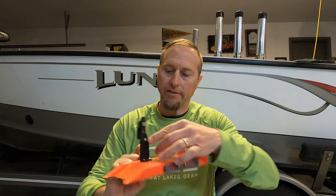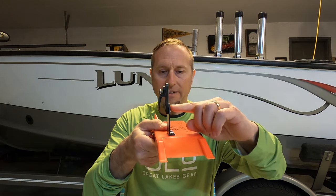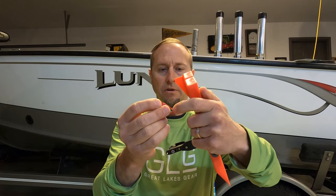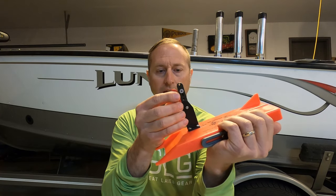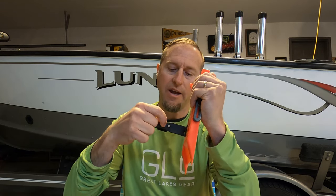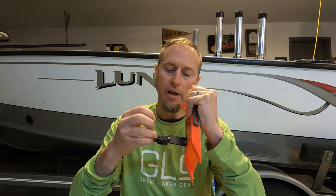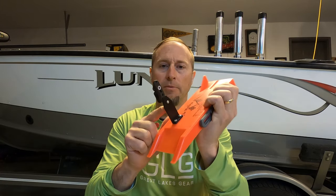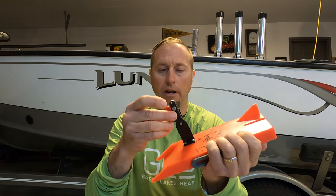So you've got this little screw and little nut here, and I'm going to pop that out. There's also a little plastic bump that pops out, and I can actually put this in that bump so this thing won't move — otherwise it might swivel back and forth. I've gotten a screw and a nut as well. We're going to have to plug this guy up with JB Weld because it's probably compromised this little plastic piece slightly. Then JB Weld that up, drill a hole here, put a similar screw — I found a wider screw that'll fit that hole better, which I'll tell you what size that is — and we'll put this thing together.